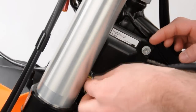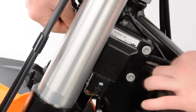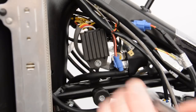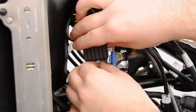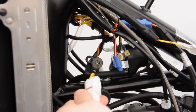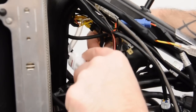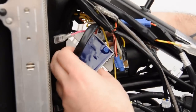Once routed, reinstall the CDI by tightening down the fasteners, paying attention to the torque specifications found in your service repair manual. Locate the regulator rectifier using the 8mm socket and remove the stock regulator rectifier from the frame rail. It can be found directly in front of the ignition coil in the Y of the frame. Once removed, disconnect the stock 4-pin connector from the OEM regulator rectifier and remove it completely. Reinstall the Trail-Tech regulator rectifier opposite the removal process using the same 8mm fastener, and reconnect the Trail-Tech white 4-pin connector into the stock 4-pin connector the OEM regulator was removed from.